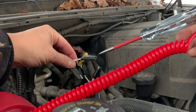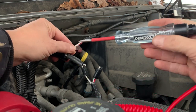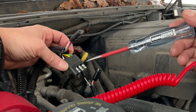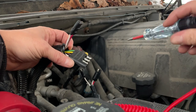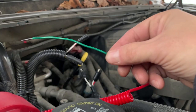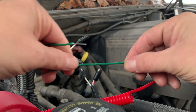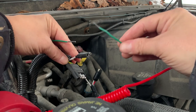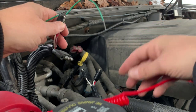All right guys, here we go. Here is the power from the truck side right here — as you can see we have our 12 volts, the white wire is the ground. Now these are the wires that are going to require power. I just happened upon the instructions by accident on the internet. I made myself a couple of little jumper wires — pretty simple, just some stripped retaining wire. Being very careful — this is fused, so if I happen to ground it out that's fine — I'm just going to jump it.